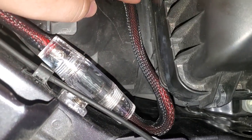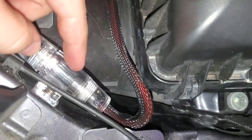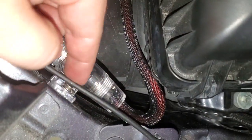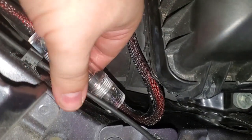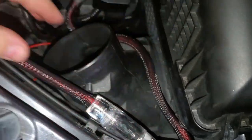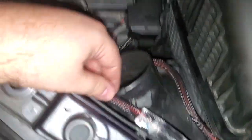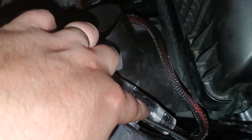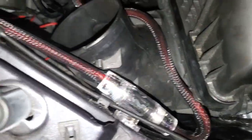Everything here is rated — this is rated for 100 amps. The fuse is 90 amps, so we're just a little below the rating and not maxing it out. Used stainless steel screws to screw this in, top and bottom right here. Made sure that when the air intake assembly gets attached, it's not going to be in the way. I oriented the fuse so I can clearly see whether it's blown or not, and also have access to service it if needed.